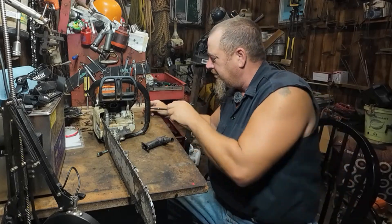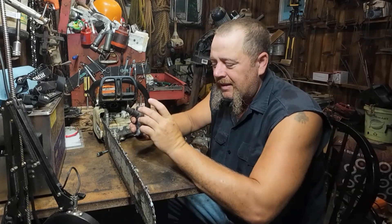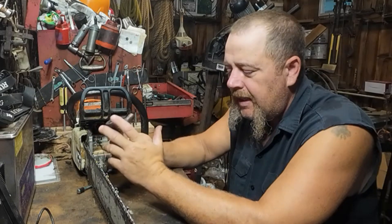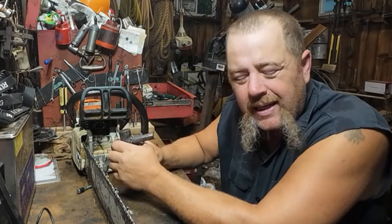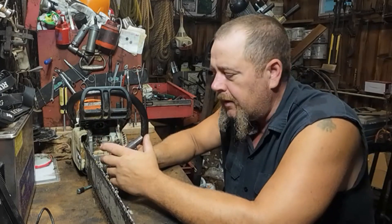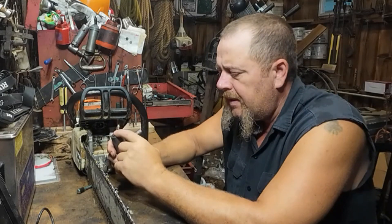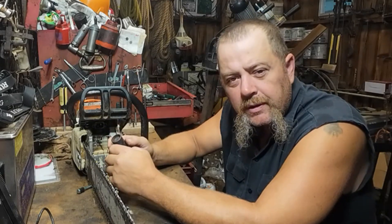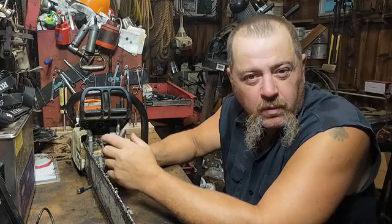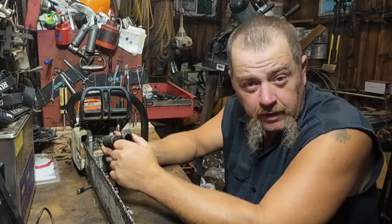One of the first things I want to get out of the way — we call this an iron horse pipe because that's who gets credit for making it, and they don't normally look like this. I made it adjustable. Iron Horse — old Harvey — he designed this pipe not necessarily thinking it was the best, but he's a guy that wants us all to work on our own saws and show us stuff. He built a pipe basically anybody with just a modicum of tools can build. If you've got a welder and a little patience, or a torch and brazing, if you can glue two pieces of pipe together and cut out a flange, you can build one.